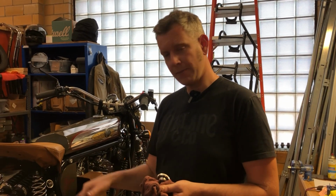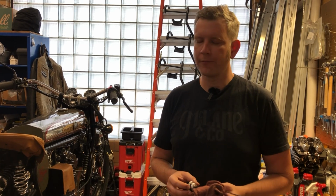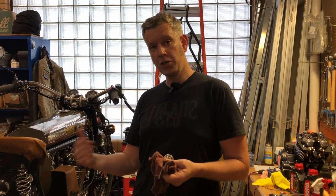One thing I did forget to mention, and we've already done that since we brought the bike inside, is you want to wait, I don't know, 3 to 5 minutes after you come back, because your oil is going to be sloshing around, and maybe it could have a little bit of foam on the top of it. Just letting it settle down for about 5 minutes is a great idea. That said, on the other end of that, when your engine's hot, you want to perform the check when you get back within about half an hour, so before the oil starts cooling off again. So those are your rules of thumb for checking the oil.